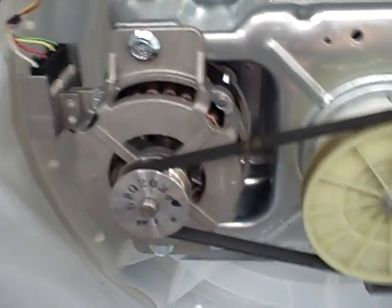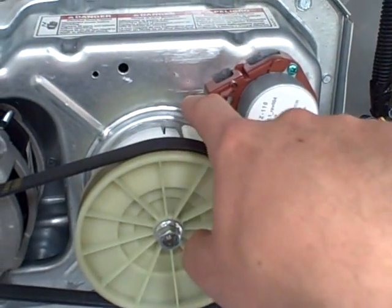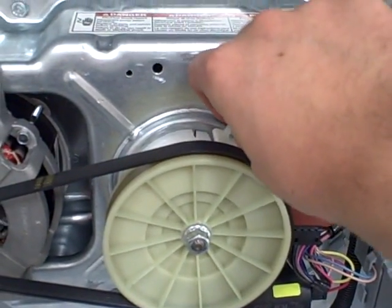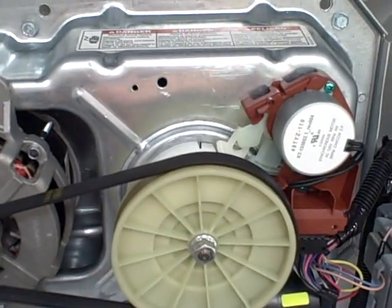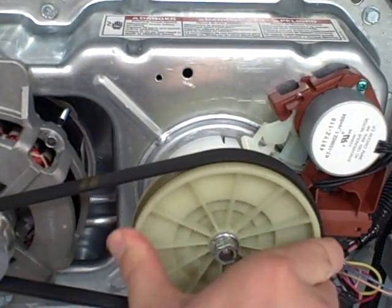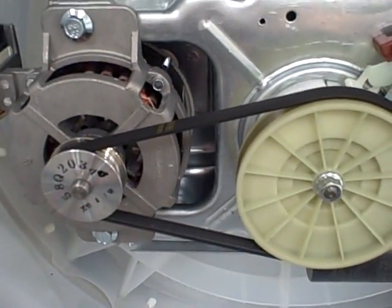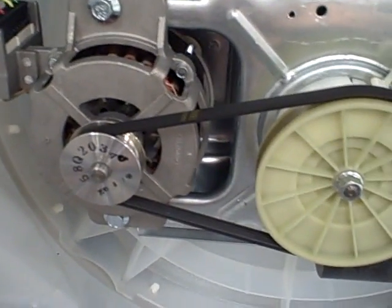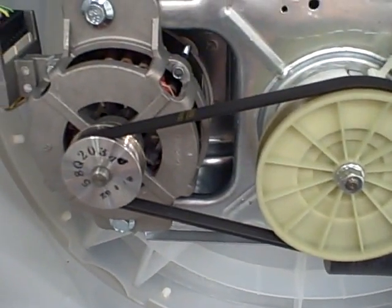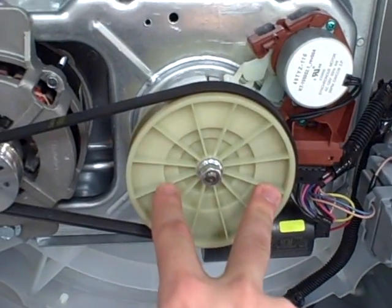When the washer is in washing mode, the synchronization motor adjusts and engages the agitator by moving this directional piece. Once engaged, the motor spins one way, then reverses and spins the other way — it does that constantly during washing. The motor is designed to do exactly that, so reversing directions does not hurt it at all. When it goes into spin, the synchronization motor then disengages.